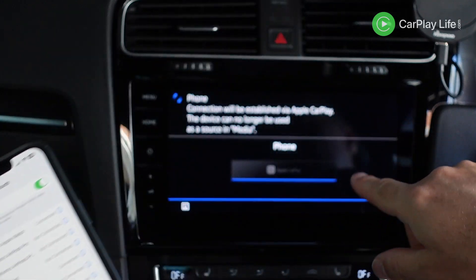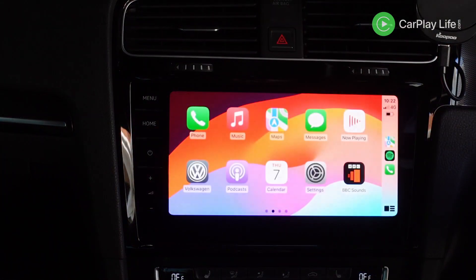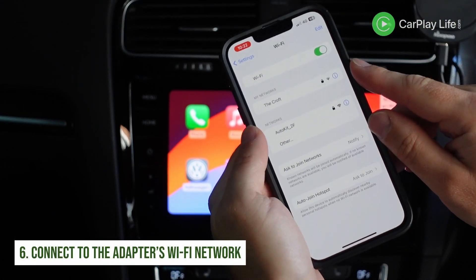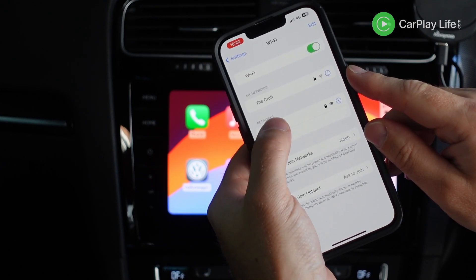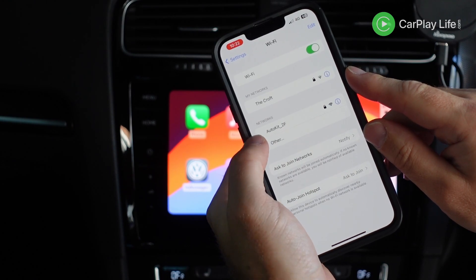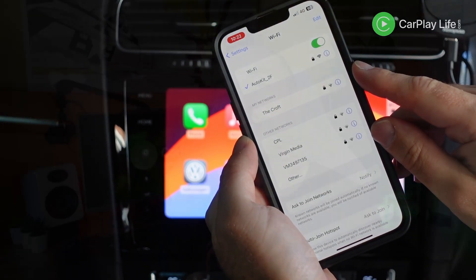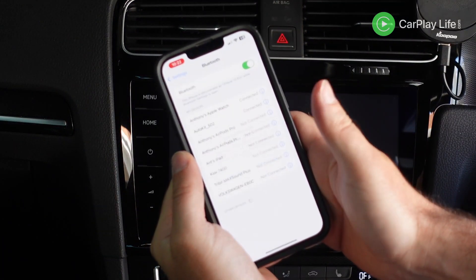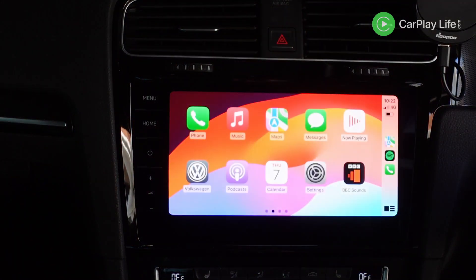If the Bluetooth ID appears, simply connect to it and you should then be asked to connect to CarPlay. After confirming, you will see CarPlay show up wirelessly on your car's display. If you've already connected to Bluetooth and the adapter is still not showing up, try searching for the adapter's Wi-Fi network. Make sure both your Bluetooth and Wi-Fi are enabled on your iPhone. If your wireless CarPlay adapter doesn't show up, connect Bluetooth first, and if nothing still shows, go into your Wi-Fi settings and look for a new Wi-Fi name from the adapter. Select it to connect, and if you're asked for a password, try the passwords shown here. Once connected, you should be asked to connect to CarPlay — confirm it and CarPlay will display on your car stereo screen.